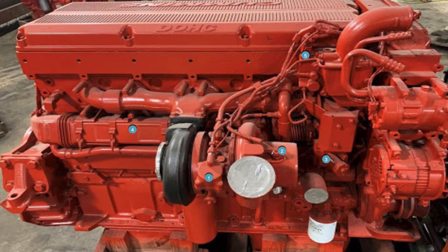Number three is the EGR valve, just behind the alternator. This was called a hot-side EGR. On the next generation they moved it to the other side of the EGR cooler so it received cooler gas. The hot-side EGRs did okay if everything was right on the engine, but if you got a boost leak or a hole in a charge air cooler, you would cook that valve. The gears — sintered iron mechanical gears above the motor — would get so hot they would swell and bind. So that was a known problem.